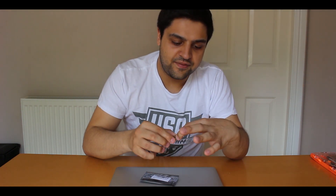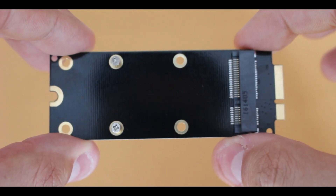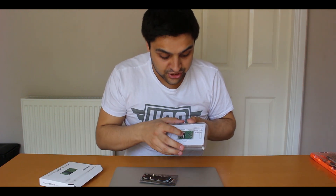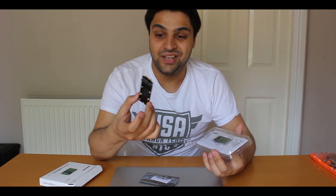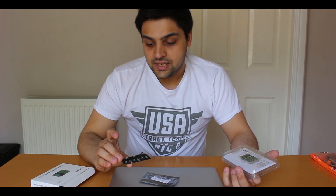This card has the 17-and-7-pin connector and converts it to an mSATA connection. I've bought a Samsung 850 EVO mSATA SSD and essentially I just need to pop it into this adapter board, screw it down, and then open up the MacBook and swap it out with the existing hard drive. So let's give it a whirl.